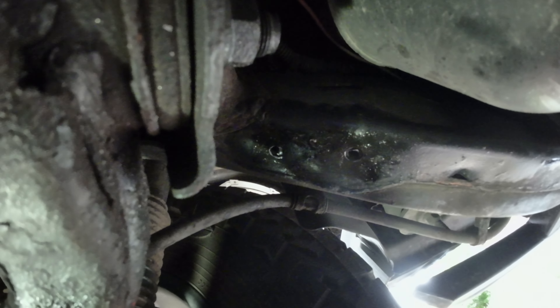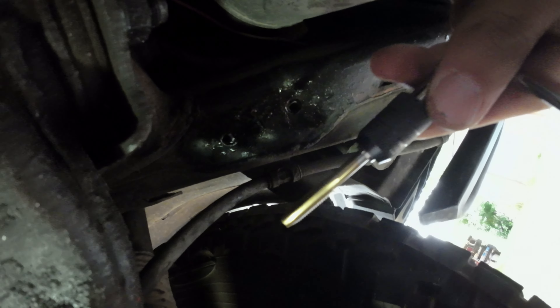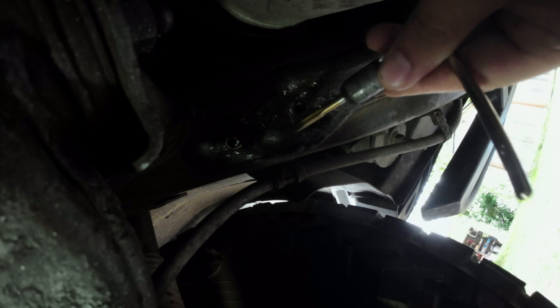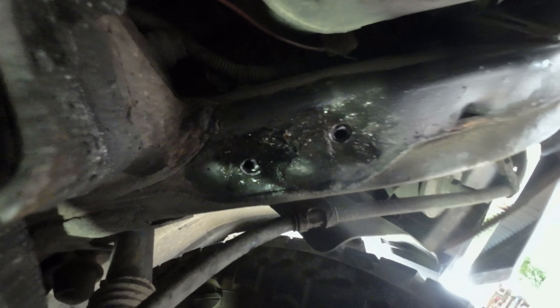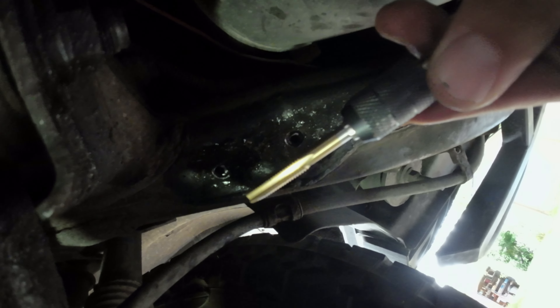We're back in business — three days and two packs of cobalt drill bits later. We got all the bolts from the sway bar bushing brackets drilled out. Now it's time to tap the holes. I'm going to use M8 by 1.25 thread and hopefully it fits in the holes that I drilled. If the tap doesn't fit in there, I'll just get a bigger tap — like an M10 by 1.0 or 1.25 — and tap the entire frame. But it looks like there's a little bit of an insert in here that I could actually use. Fingers crossed we tap these in here and move on with the install.